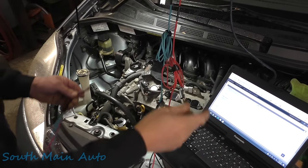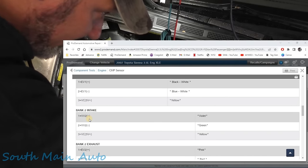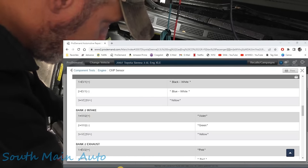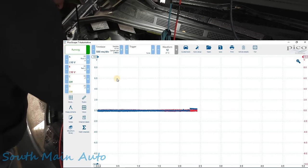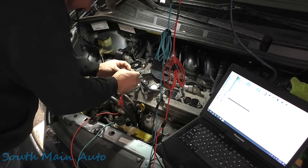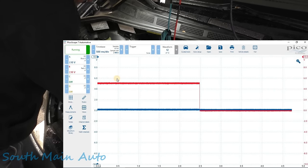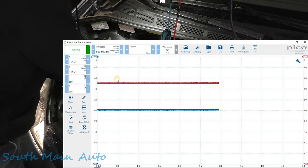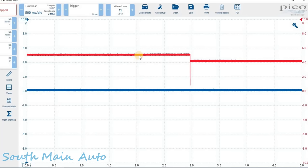Hopefully our screen recorder is working - the one on this laptop is kind of a crappy one. So our bank two - we can see this here. Our VV2 plus is purple, which matches there, and our five volt is yellow. I've got our negative side of our scope hooked to battery negative. I've set it up at 10 volts, 500 milliseconds on the screen. I'm going to unplug this to see if we have our five volts. Got some kind of goo in here. It looks like we have our five volts present. This connector is not in great shape - the wires are kind of crumbling apart on the back. I've back-probed into the purple and we do have five volts there. It pulls it down a little bit - was at five volts when I plugged it in, dropped it down to four volts.